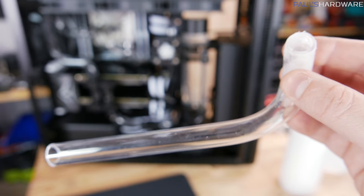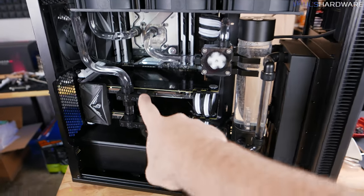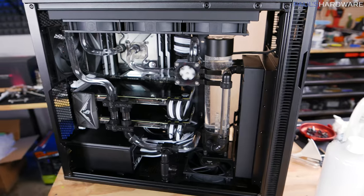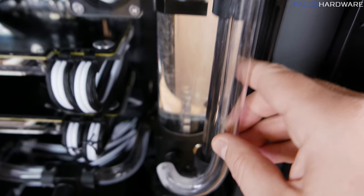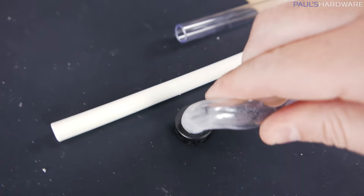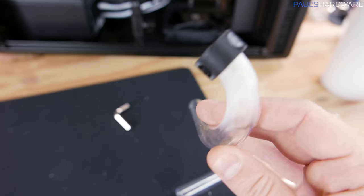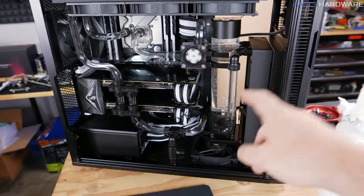This bend was what basically killed my evening last night, because I had everything set up. I got all the bends done, I had them all in place, I just didn't have the fitting caps on all of them. So I went to do that really quick last night, finish it up, and then I was going to pour some water in, because I promised you guys that I'd have water in it by the end of today's video. This was what I called my J-bend, and I had actually replaced it right down there. It looked pretty cool when it was in there. It helped me not use quite as many fittings to get this vertical part right here. But when I attempted to actually put the cap on the end, it just didn't want to go in there, and that's because this is part of the bend right there, and so the uniformity of the roundness of the tubing had been warped, and therefore the cap wouldn't go on. So I tried to salvage it, started sanding it down and whatnot, and eventually I was just like, I hate it now and it sucks, so I had to scrap that piece and go back to my original plan of using a few adapters on there.